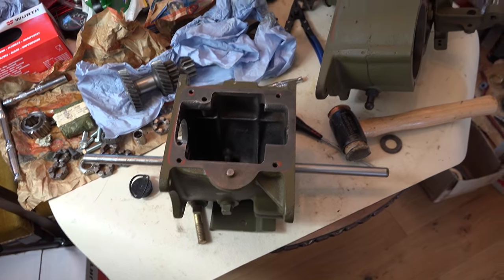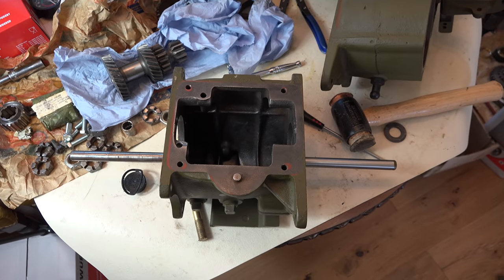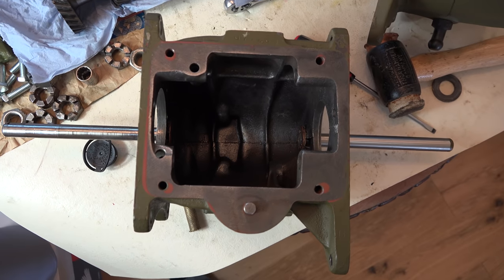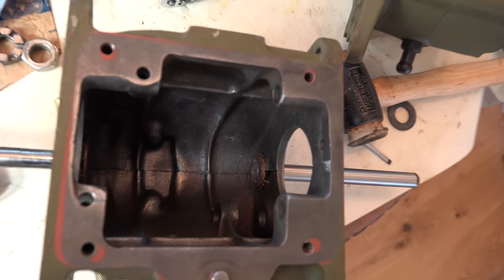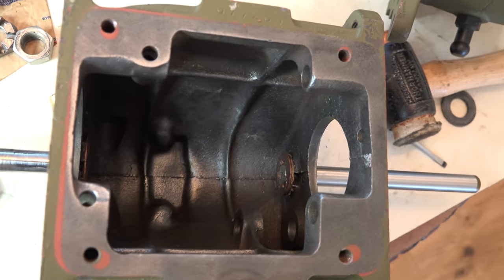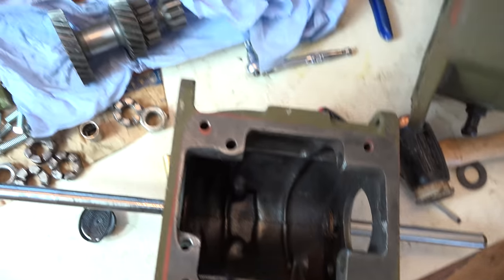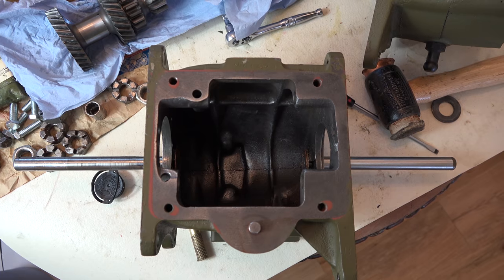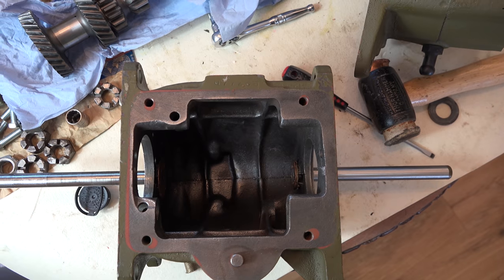She's all gone apart again - which just adds to the fact that I absolutely hate working on transmissions and transfer cases. Love building Jeeps, hate transmissions and transfer cases. But I'm keeping it together. I've got two shafts - an old main shaft and a new main shaft. I put a whole load of grease on the washers set up at each end so they're held in place. The main shafts are just going through enough to help keep the washers in place. Then I'll try to drop the cluster gear in from above without knocking them off. It's really difficult - you'll have to do it a couple of times, it'll make you swear.